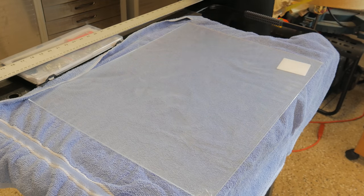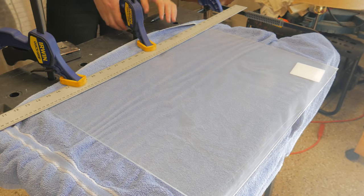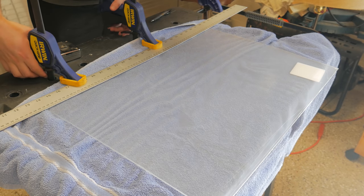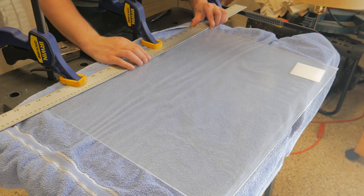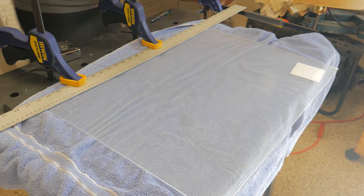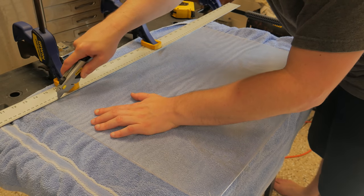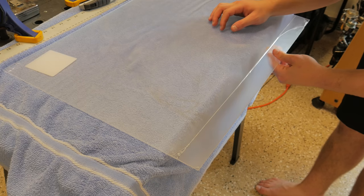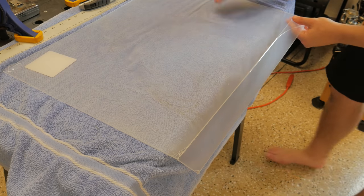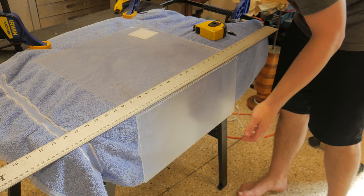For this panel I needed a thin sheet of clear acrylic, some magnet tape and something to make a border. Some people use paint, I used vinyl. Basically I laid out my sheet of acrylic and measured out the two cuts I'd need to make the perfect side panel. The best method I found is to score and snap it. They make specific scoring tools which make the process a lot easier, but I used a regular box cutter with a few razor blades. I used a straight edge held in place with a few clamps and then ran the blade over this line a few dozen times. Once the line is scored pretty deep I took it to the edge of the table and snapped it. With a faster snapping motion that worked well. Once the panel was cut down to size it was now time to make it so it could mount to the case.